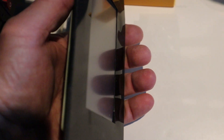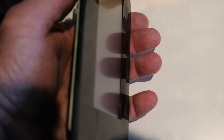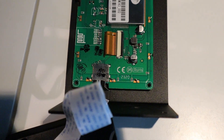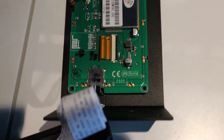It's only held on by this front sticker. I'm trying to hold the camera with one hand while doing this demo with the other, but as you can see, that sticky tape is all that's holding the screen in — it's just the back with the four screws. Once they're out, all that's holding it in is that tape. So if you find you can't pull it forward, just peel that tape off the screen and you can pull it forward, then plug the extension cable in. Once you've done that, put all the screws back.